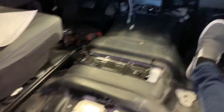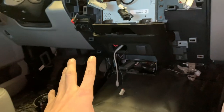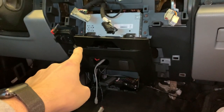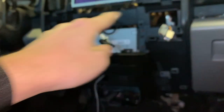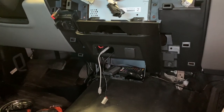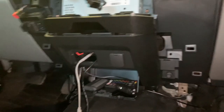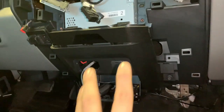The jump seat is already out. Next is removing this big piece, and then we can put in this piece, which has a Ford part number that I'll put in the description. I bought this as well as my vents from TASCA — T-A-S-C-A, TASCA.com. They're an awesome parts distributor. To get this out, there's a 10mm bolt and another 10mm bolt — I already removed one and loosened the other, so that's ready to come out.